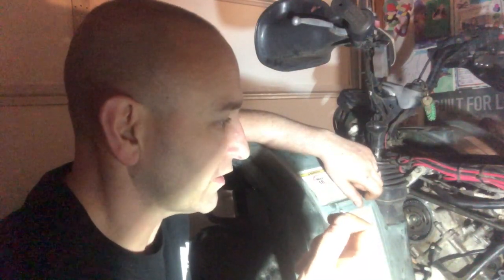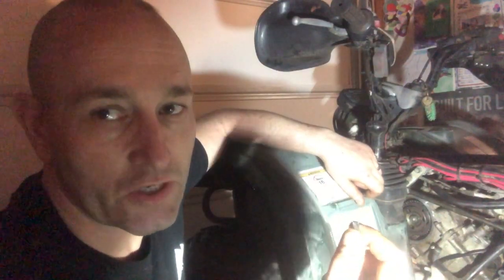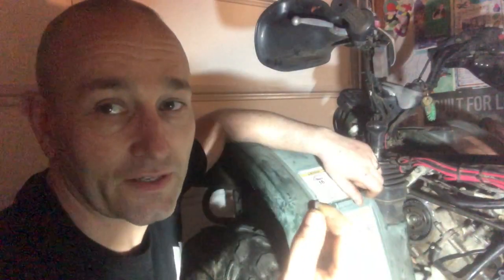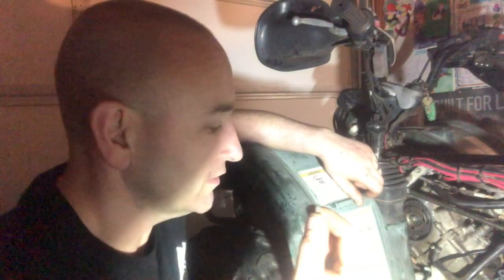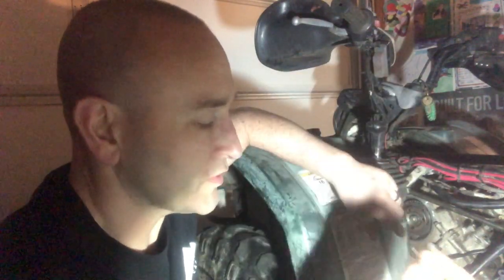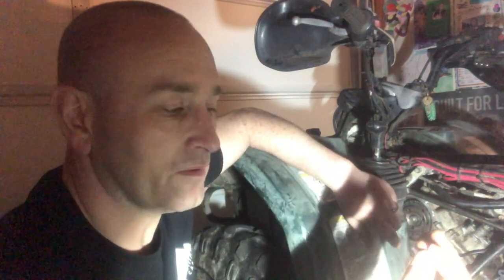So kind of a tricky one to find, but I thought I'd put a video together and explain what went on with it, because I searched for some information on it and couldn't find too much information on it. And I did not find any information on these keys breaking. I'm used to working on automotive cars, trucks, light trucks, buses, stuff like that. So this I don't usually see. I have seen pulleys that were stripped out, but to get a Woodruff key that's broken, that's quite unusual.